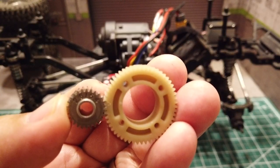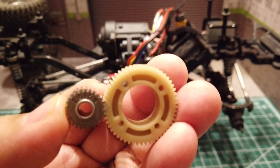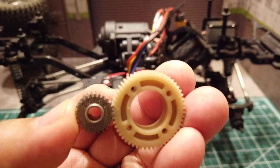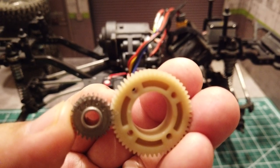Here are the two parts that you will need to change the overdrive from 5.7% to 11.83%. This is the 26 teeth gear and this is the 54 tooth gear. In comparison, the stock uses 27 teeth and 53 teeth gears.